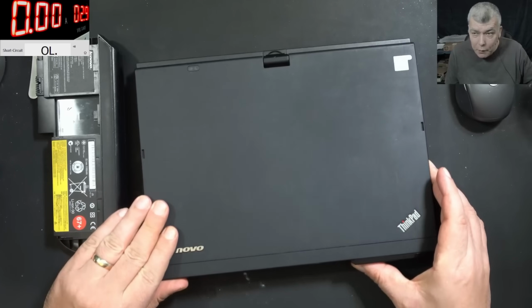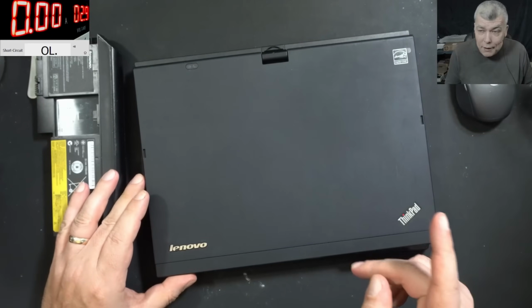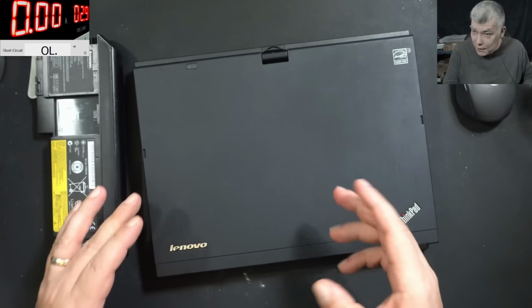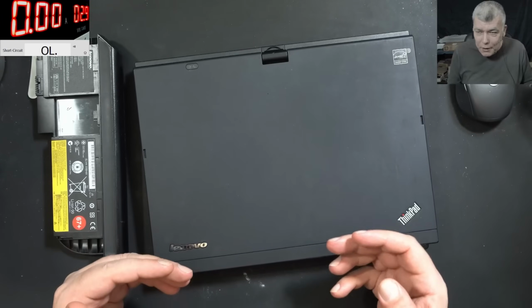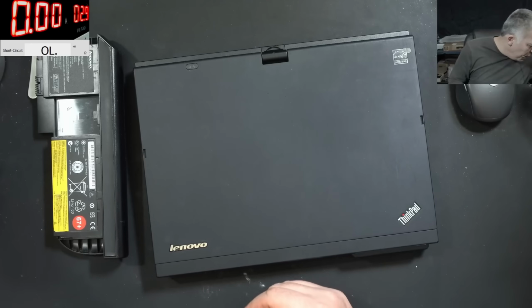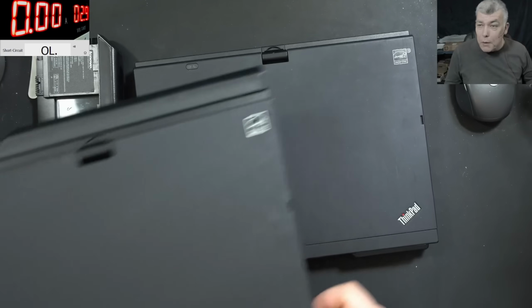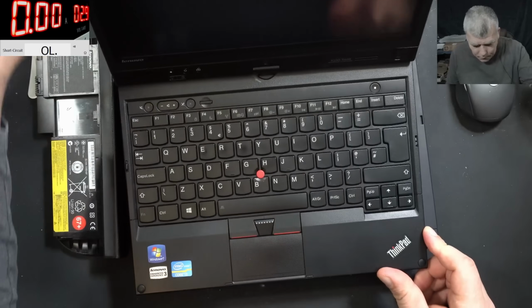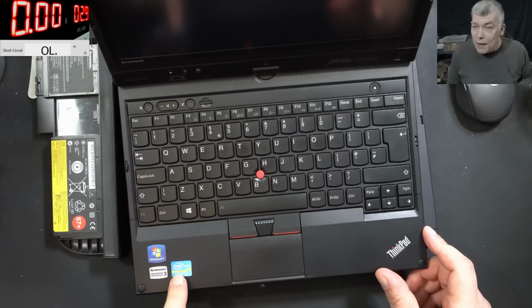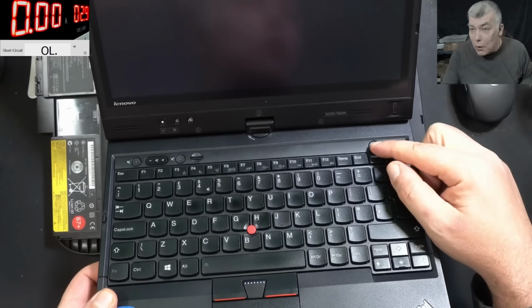So this is kind of an old laptop, but the customer wants to repair it, right? He sent me a good laptop to fix this one. I mean, clearly, probably he has some software tied with the hardware, or it's about some data recovery. Because we have exactly the same laptop here, a working laptop, but this one has an i3 CPU. So the only difference is the CPU. So you cannot swap the board.